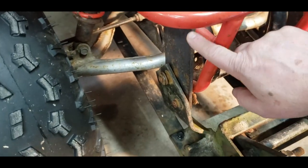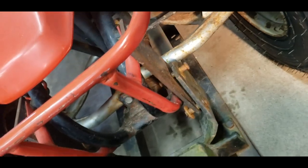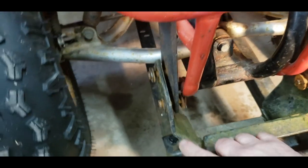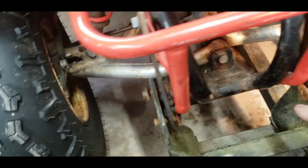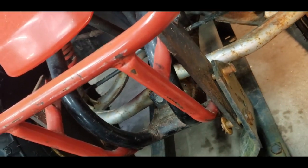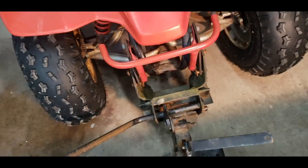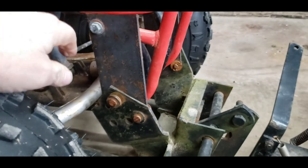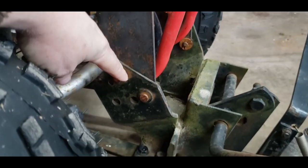What I did is I made these steel flat plates and just bolted them to the existing bolts on the ATV on both sides. This part was already part of the plow from whatever it was mounted on before, so I just drilled holes in my plate to add this and pin it in. It can be easily removed for the summer and put back on in the winter.